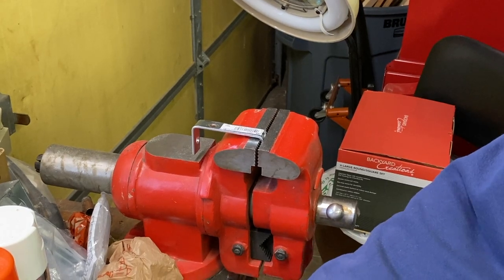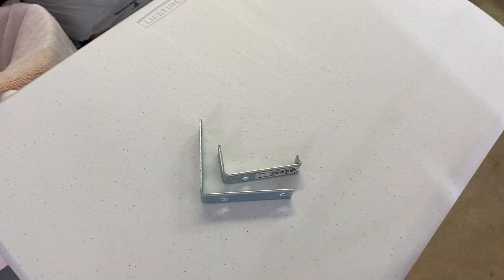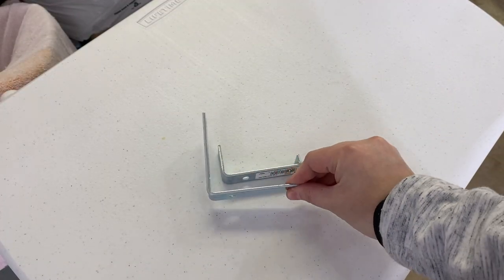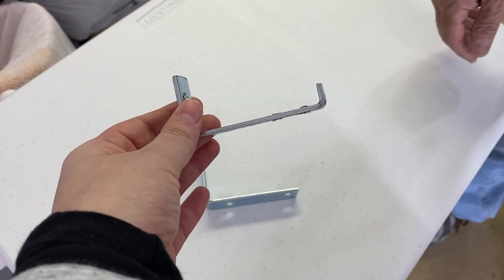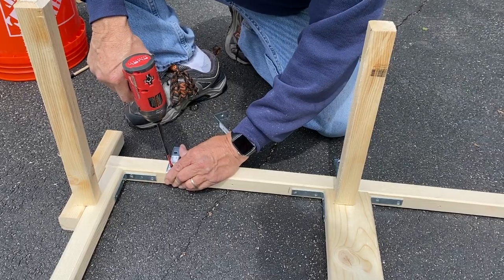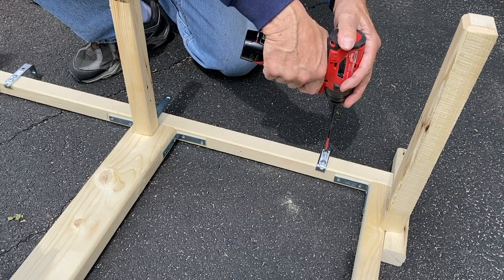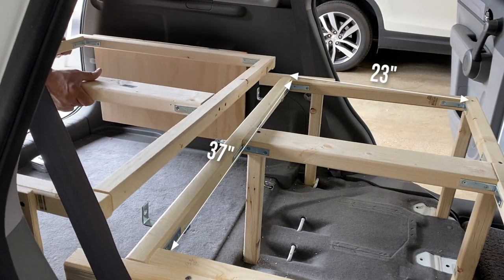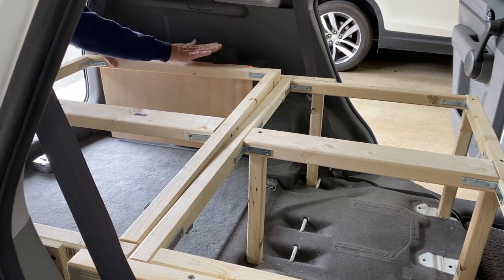Since all this is doing is just holding it front to back, a little bit of play doesn't matter as long as it can drop in. These brackets are really just to keep the back piece and the front piece together. You don't have to get fancy and use metal — you can actually just use zip ties. That was my original plan if the metal didn't work out, and if I needed to get to my trunk for my tire I could just cut the zip ties and make sure I had a few spares. It's really just to make sure the two pieces stay together and don't separate when I'm driving down the road.